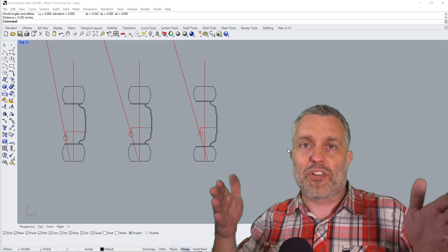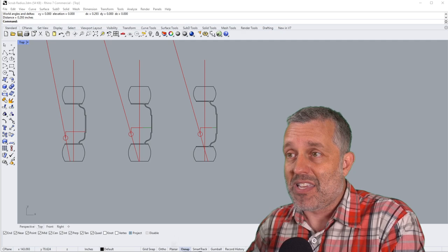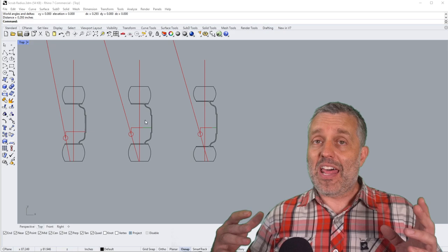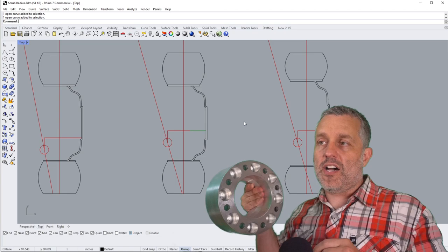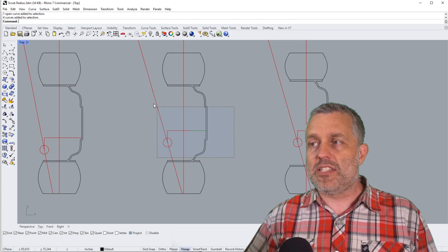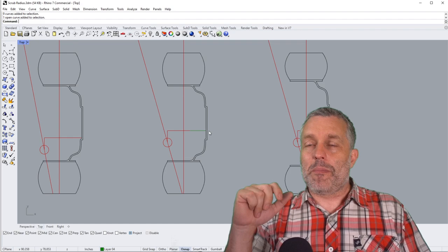The bottom line to me is once again: never deviate from stock. Even though this spacer does outboard those front wheels so they're tracking true to the rear wheels — which tracks better on rutted roads where tractor trailers have put depressions in the lane — I don't think that benefit is enough to justify the increased dive. If I want to get back to stock wheel spacing, I need to look at my CAD drawing. The green line represents the spacer — the far-left drawing is the stock setup, and the current setup is the one-ton upgrade. If I decrease that spacer by two inches, I'm right back to where the wheels were tracking in the stock setup.